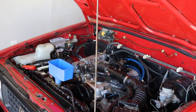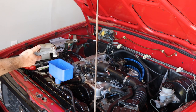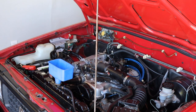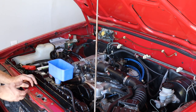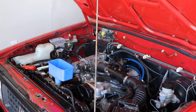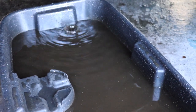Let's go ahead and flush this radiator out. Yep, brown and crusty. I'm going to run some straight hose water, fill this thing up, heat cycle it, let it cool, and then drain it. We'll be able to run our ThermoCure right after that. So let's reattach that hose and fill up the system. The color of this water just coming out from flushing the radiator — yeah, that's pretty disgusting. We're going to keep doing that until it runs pretty clear, then fill the system with water and run it to operating temperature.